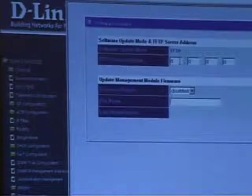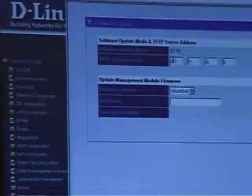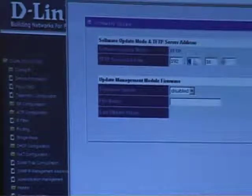And so once you're in there and you have your TFTP server running, you would go back to the administration web page. And in the left-hand navigation pane, there's a firmware update page. And this is exactly the same as it would look if it was the MGCP adapter that we'd gotten into. So typically you'd say, okay, I want to update the firmware, and what's the address of my TFTP server? Well, it's the same as my computer. So we've gone back over to here, and we see that 192.168.0.16 is our IP address. So we'd enter that as 192.168... yeah, too fast.